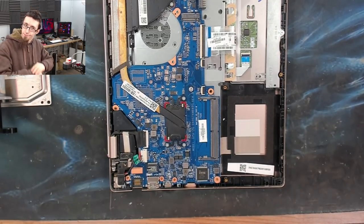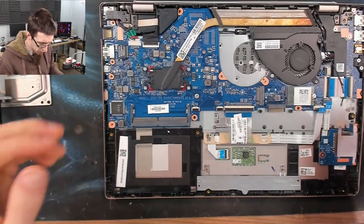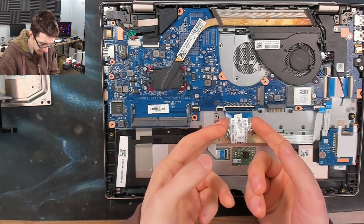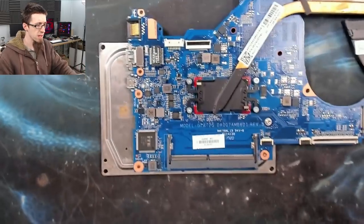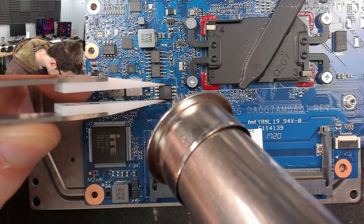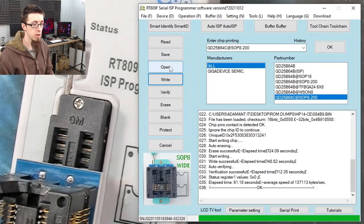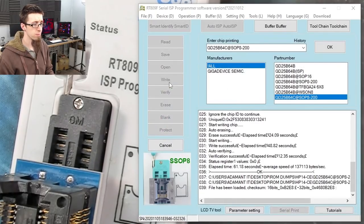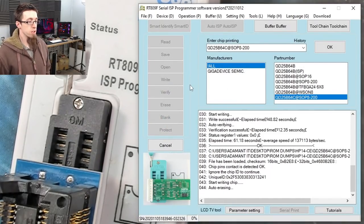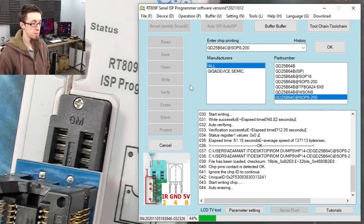I'm going to take a break first — always remember to take breaks when you're working on stuff, keep your head clear. We win! However, we've got to restore that BIOS. Let's get the motherboard back out again. Bit of a bummer we went through the faff with the BIOS only to find it wasn't the BIOS — but hey, that's how it be sometimes. Now we're just going to open our dump file — there's the original bin — and write that back. I'll give it another post-test after doing this before screwing everything back into place.